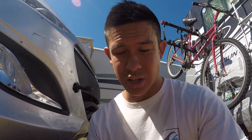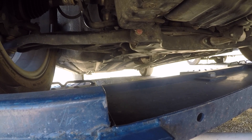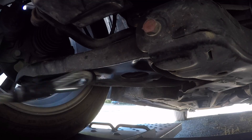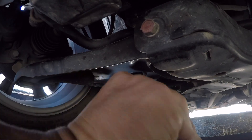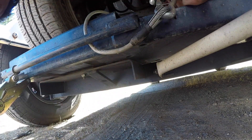You'll want to run the safety chains through the frame of the car, but leave some slack because the suspension needs to be able to bounce on the ramp. With the Hyundai Elantra there's a convenient hole in the arm going to the tire — I run the chain end through that hole. Each vehicle is a little different, so you'll have to find something that works for yours.